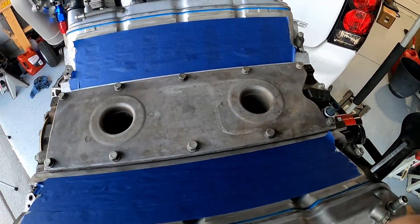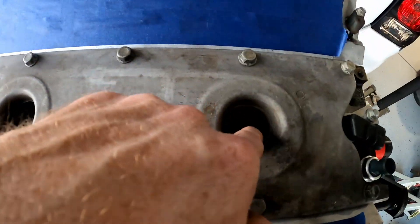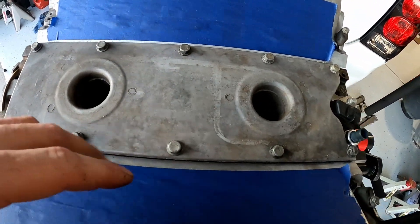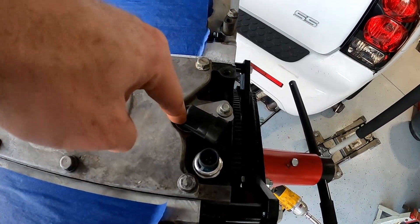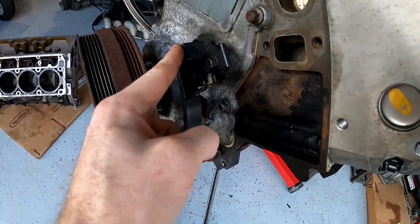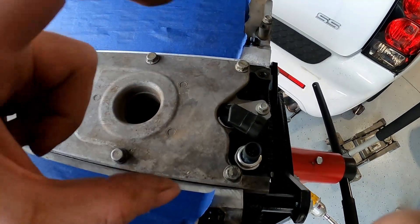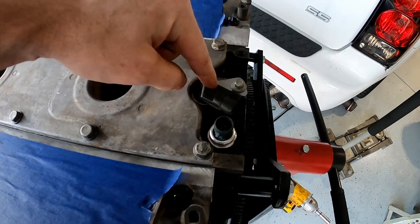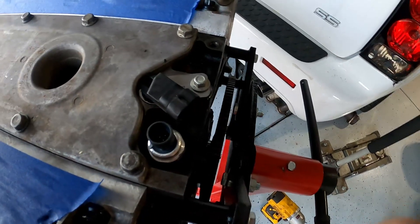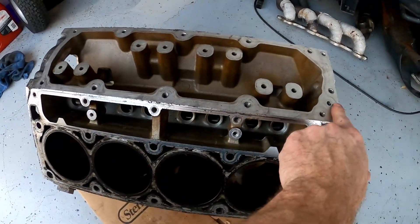The other thing is the valley cover. If you look at the top of the engine, you have your typical valley cover with the two knock sensors. For this block I'm going to use the valley cover that has the holes but not the knock sensors obviously. You're going to have a hole here because the LS2 block uses the cam sensor at the front cover instead of the back. To plug up the hole, the actual piece was like $40, so I looked in my parts box, found an old cam sensor, and put it in there just to plug the hole for now — it's a cheap fix.